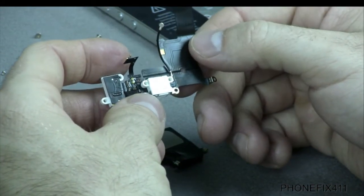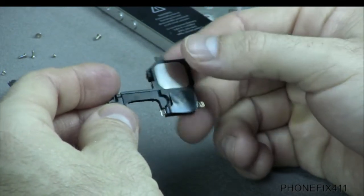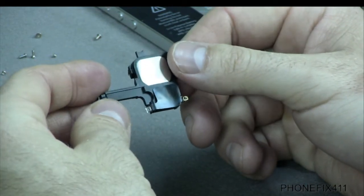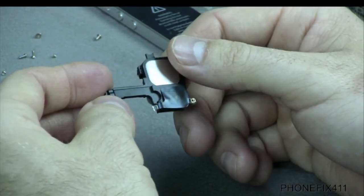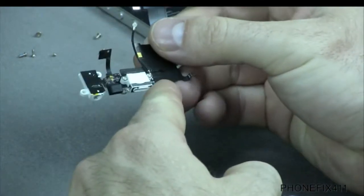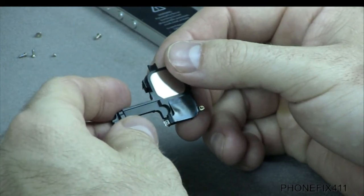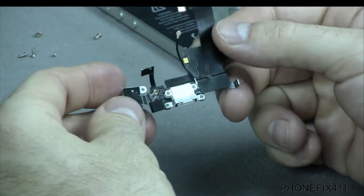If the plug is in, then it's probably safe to say that either antenna A or B has gone out. First replace the charging cable microphone module; if it still doesn't work, then you can try replacing antenna B. This antenna doesn't come up as easily when you search for it online — you'd have to search for 'antenna GSM.' We're not going to show changing it out here because we already covered the charging cable microphone repair and the ringer loudspeaker module, so you can watch either of those videos.